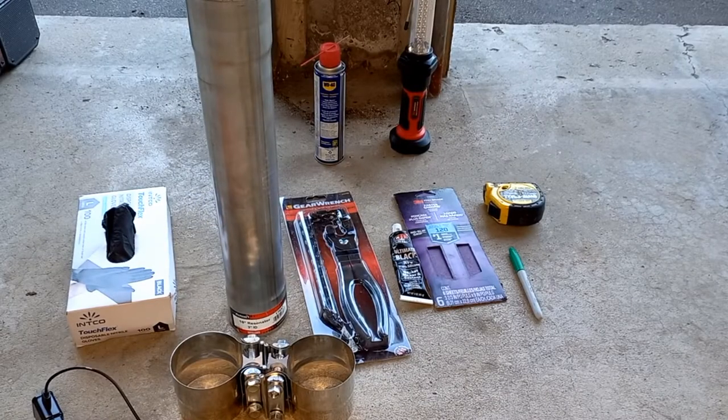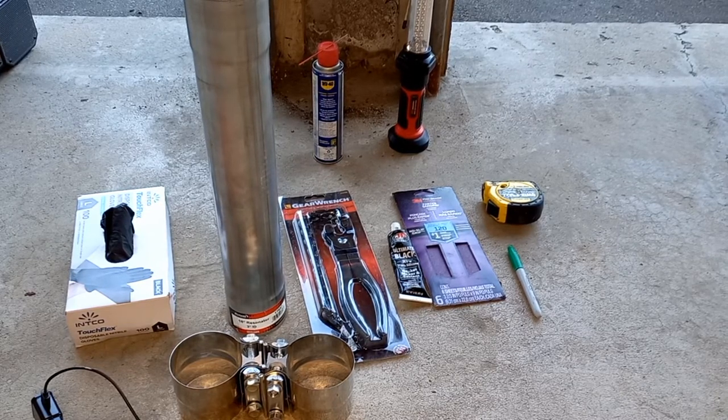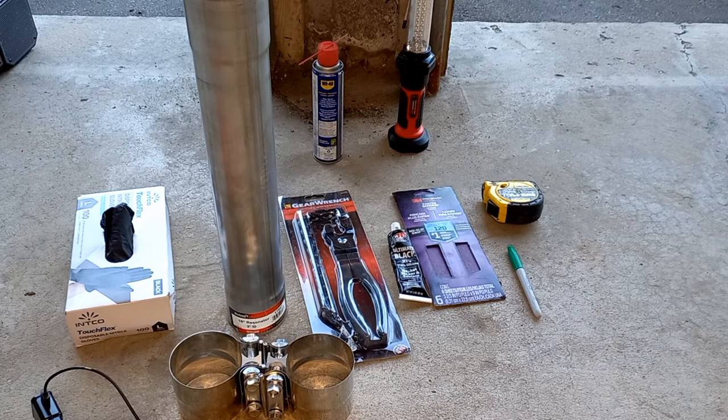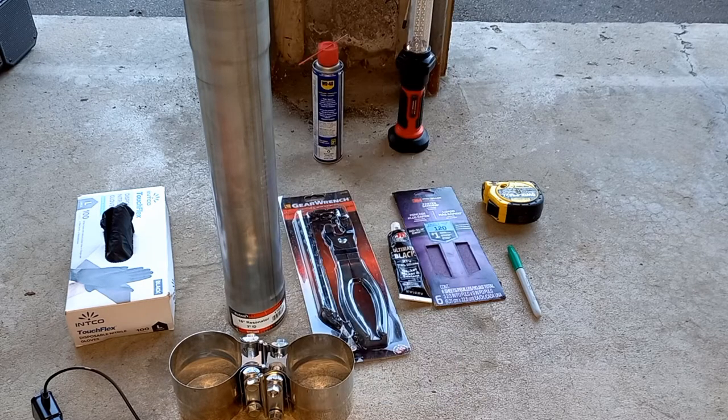So to do this mod, we will need an 18-inch, 3-inch interior diameter resonator pipe. I'll have all the links to everything I use in the description below, as always. That pipe itself is what we'll be using to delete the resonator. Two butt joint clamps. In the video I did see, which I'll make sure to put on screen, JD Cars, for the inspiration, he used butt joint. And I believe the way this exhaust works, I think lap joint might work better. If not, then we shall still make it work.